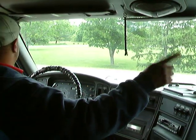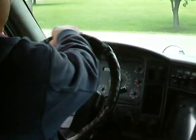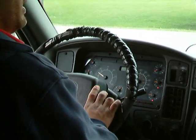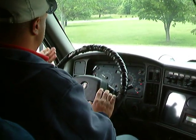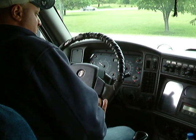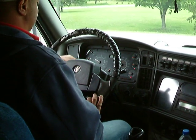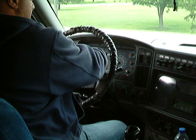Then you're going to do your in-cab. Hands out — you're pointing to your mirrors. Mirrors are properly adjusted, no cracks or damage. Let your hands fall to your steering wheel. Steering wheel has no more than 2 inches of play. Call out everything on the steering wheel — your city horn and air horn working. Hand falls to the left, right to your turn signals. Left turn signal works, right turn signal working, 4-ways working. Done with that, point at your gauges. Water gauge, volt gauge, oil gauge are all working. Fuel gauge is working.